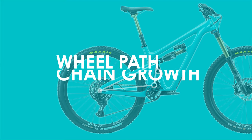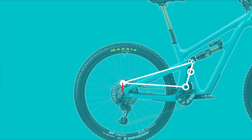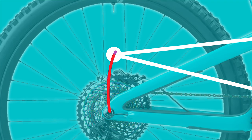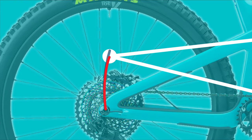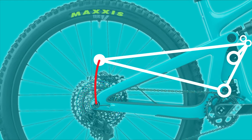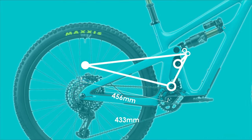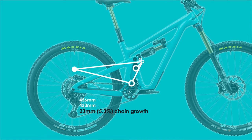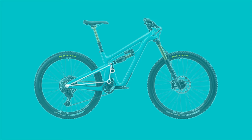The last thing to cover is the wheel path and chain growth for the SB150. Overlaying the various wheel paths calculated so far, you start to realize how almost identical they all are. The 160mm Megatower continues along the same arc as the SB150, while the 170mm Ransom only starts to deviate a tiny bit at the end, which results in its slightly higher chain growth. In all cases, the almost vertical initial movement followed by arcing towards the front will result in good square edge performance, while keeping chain growth and pedal kickback in check. The SB150 has a chain growth from 433 to 456mm, or about 5.3%, which is very similar to that of the Megatower. For a similar single pivot design, the chain growth would most certainly be higher at full travel, as the rear axle will arc further away from the bottom bracket.